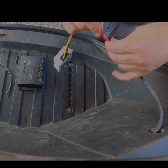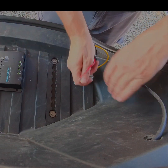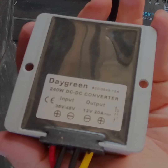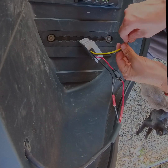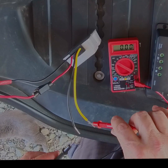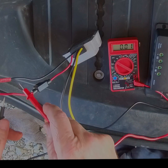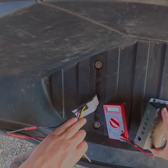We're just going to do a dry run while the painting dries. I just want to make sure the inverter works and everything before we finish the final setup. Red and black is 48-volt and yellow and black is 12-volt - 48 in, 12 out. Time for another sanity check: I'm going to turn the outlet back on and with the multimeter we should have 12 volts coming out. 12.3 volts - that is exactly what we wanted. We're getting 48 volts from the truck, 12 volts here, and we'll get the 12 volts into the charge controller which will charge the battery.